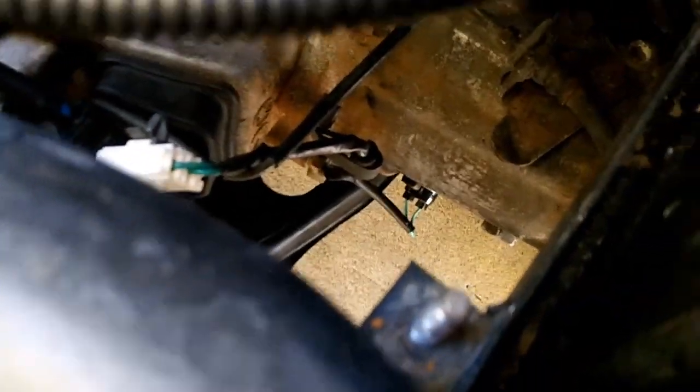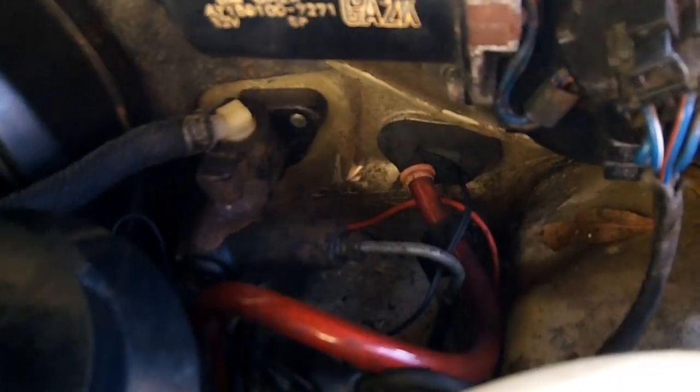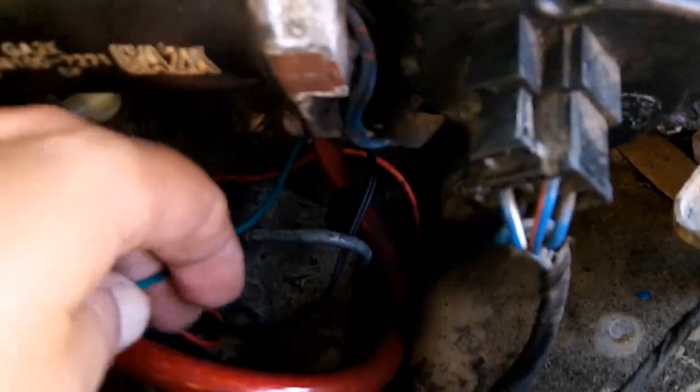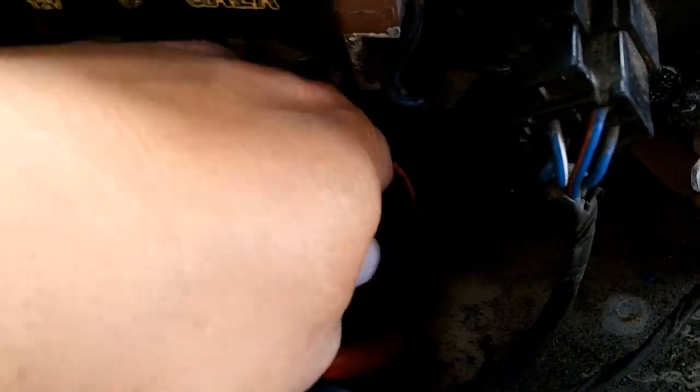There's the backup light switch connector, the little white one down there. And there's the backup light switch on the transmission. And that is going to get power through the firewall to the room fuse. So what I'm going to do, just for testing purposes, I'll make it all nice and clean later, but just for testing purposes, I'm going to put this wire back here, and then I'm going to go ahead and wire that directly up to the room fuse itself.